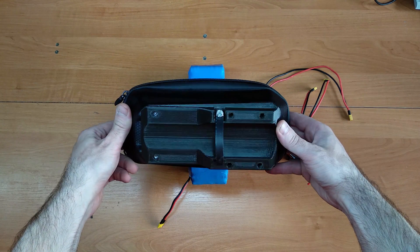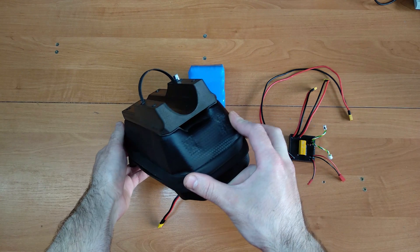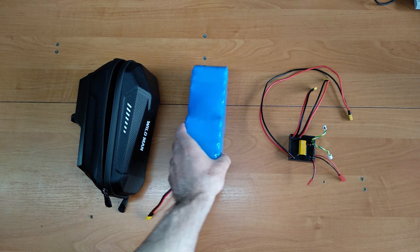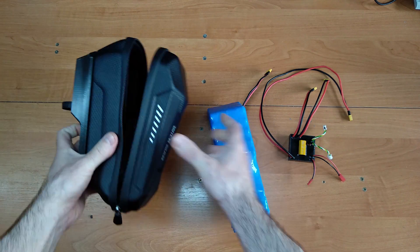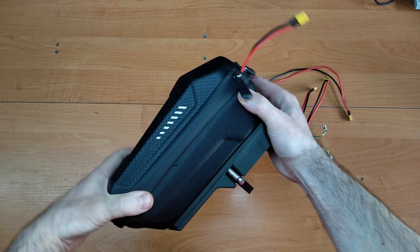The first one is a battery bag, which is equipped with a ready-made mount to the scooter frame. The mount matches the shape of the frame, so a single clip is enough to hold it securely. The shape of the battery is identical to the bag, to accommodate as many battery cells as possible. My bag holds up to 50 cells, so I can use 10S5P or 12S4P batteries.